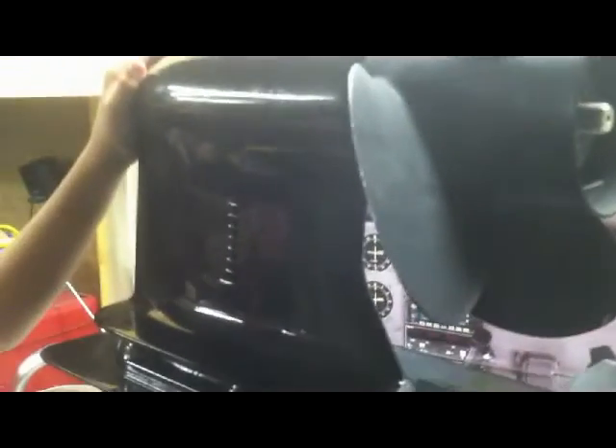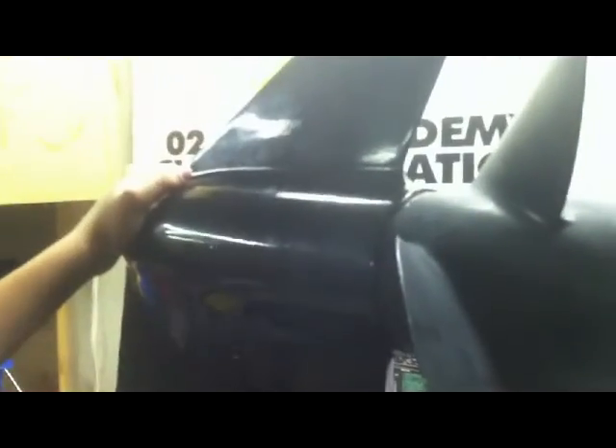Here's a shot of the completed drive, upper and lower put together. If you've done a MerCruiser drive before, it's probably nothing new to you — just lining up those hoses, the six bolts to hold everything together, and making sure your trim anode has clearance. The next step will be to get the old gimbal housing and the old bell housing off, and then install the actual conversion kit.